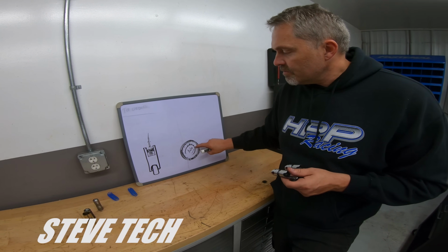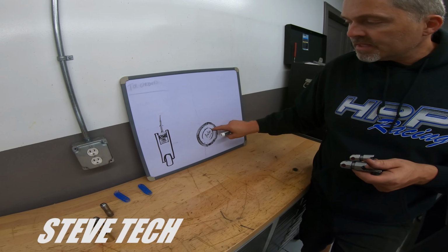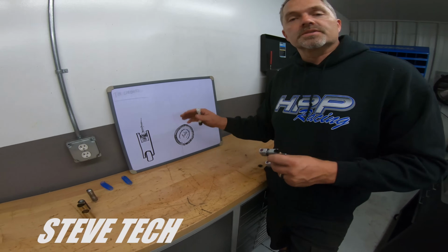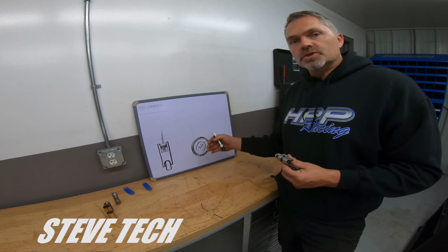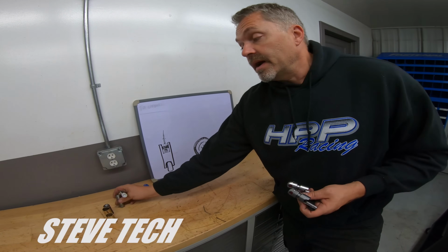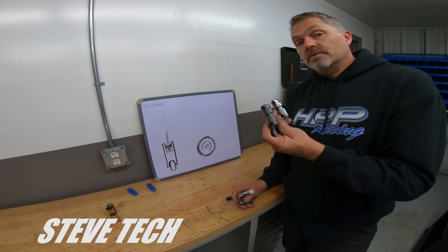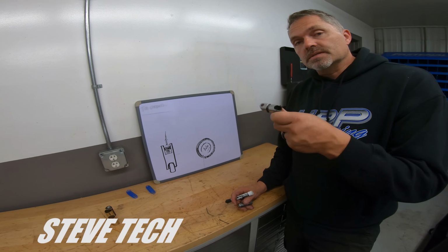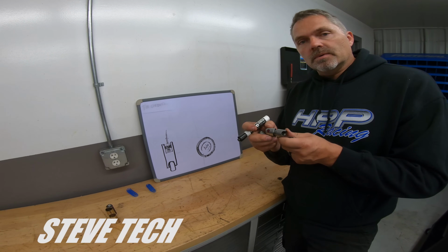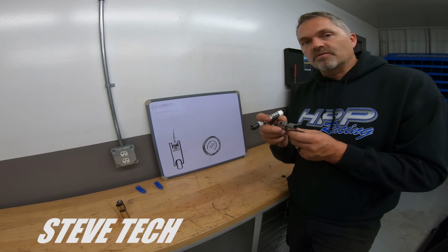Now the bushings are pretty tricky. There's a lot of different material and there's a lot of science behind all that. I'm not really interested in it. I just know that this thing works and lasts better with that bushed lifter. We can do that now on hydraulics, so the hydraulics become better, but definitely do it on the solids, because as the load profiles get more aggressive, they really get harder on that bearing, and that's why those bearings will sometimes fail.